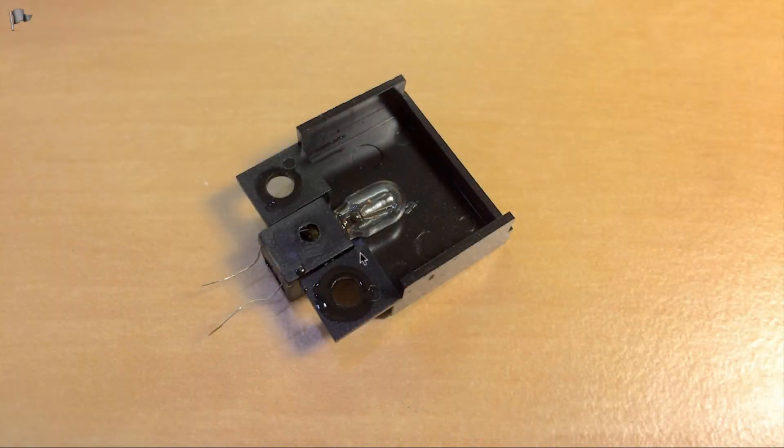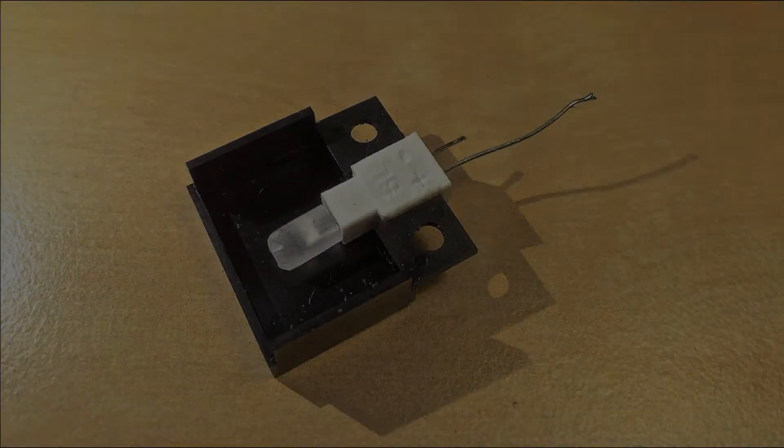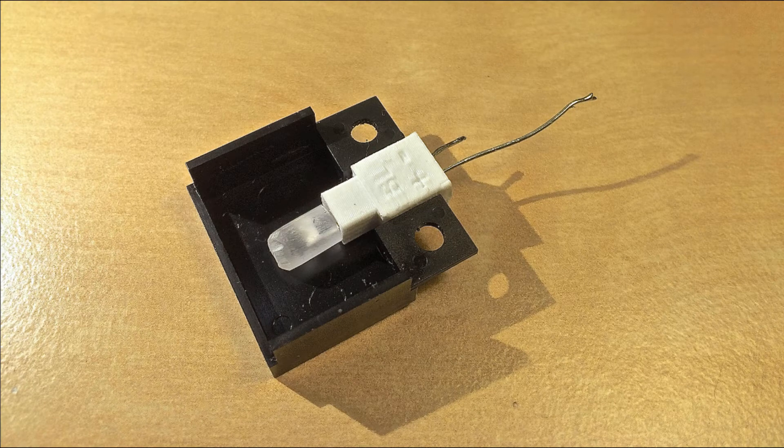This here shows the top part of the sensor housing with the built-in light bulb. Unfortunately the light bulb is glued into this plastic part, so it's not straightforward to replace it. My original solution was to replace the light bulb in the actual housing with an LED assembly — a 3D printed part into which I integrated a standard five millimeter amber LED and a resistor. What I didn't like about this solution is that I had to follow a laborious process to remove the light bulb and then put in the small 3D printed part.